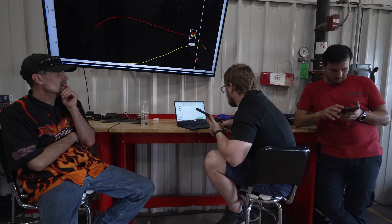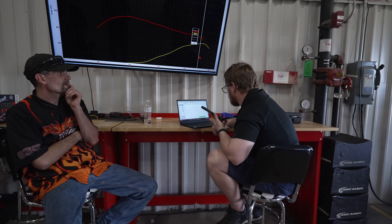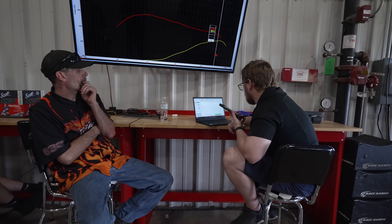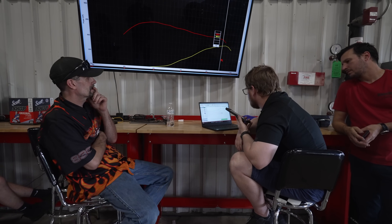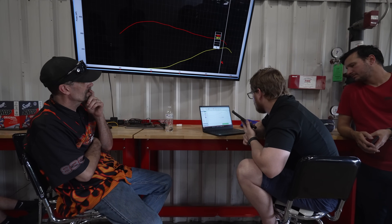So I'm at like 90 miles an hour. I have 4,900-ish driveshaft RPM, which I'd have to look on the dyno to see what that correlates to in axle speed. And it's at about 7,400 RPM, which is right where it starts to recover from where it pulls the motor down. That's what they call the boulder shift — it flares, and then there's just so much power coming in all at once, the secondary's not resistive enough.